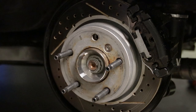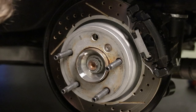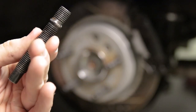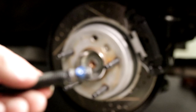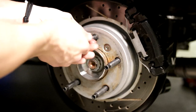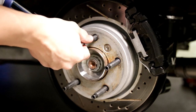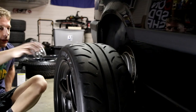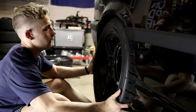Now I'm gonna do the same to the stud. As you can see, it has a bunch of crusty Loctite on it. So what we are going to do is go ahead and spray it off pretty much clean. Let's go ahead and put some blue Loctite on these and torque them down to 11 foot-pounds. Dab just a little bit of blue Loctite thread sealer on there. Thread it into the hub. Set to 11 foot-pounds. There we go, starting to get some torque. And that's it. Oh, phone. Not the same mistake 3 times in a row. Just like that.